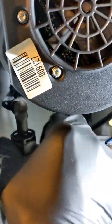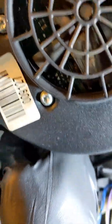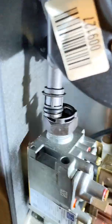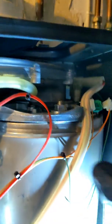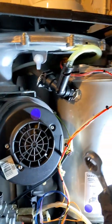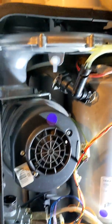That O-ring is very tight in there and it's been in there forever, so it takes some effort. Once that's removed, undo your electrode connections and NTC connections. If you struggle to get to the one at the back, open up the flap here and you can get your hand in through there. Get all those done and we'll come back to this. All the electrical connections are loose except that NTC, which will come off once we take the fan out altogether.